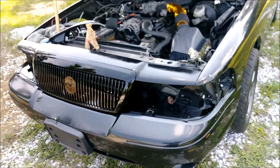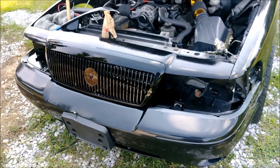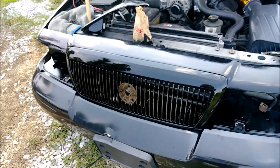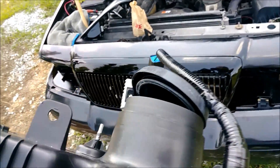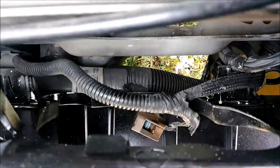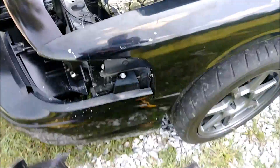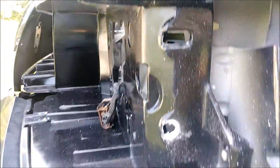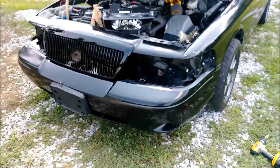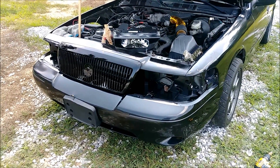This video is going to be a perfect opportunity to show you that it is mandatory - there is no way around it - you need a Marauder or Grand Marquis header panel in order to do a Marauder conversion. Number one, the grille is completely different. The Marauder grille is a lot wider, so if you use a Crown Vic header panel the Marauder grille will not fit. Second, if you notice on this headlight where the three bolts attach - on the Marauder header panel you have slots for those three bolts. Also for the corner lights, unlike the Crown Vic which uses a Phillips head screw on the side, the Marauder one has two screws on the other side that screw into the Marauder header panel. You cannot do a full Marauder front end conversion without a Marauder or Grand Marquis header panel.